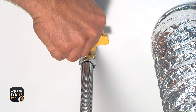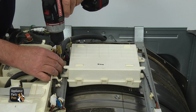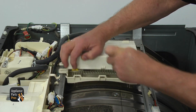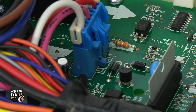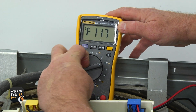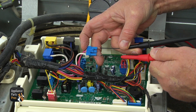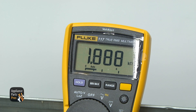If gas won't ignite, you can run a resistance test of the gas valve coils as a second test. For that, we need to get to the main PCB. Unplug the dryer and turn the gas off. With the top panel removed, locate the PCB housing mounted in the center. Remove two Phillips screws to free the housing. Using the flat-blade screwdriver, undo the tabs and open the cover. Locate the blue three-wire connector BL3 and disconnect it. Set your multimeter to resistance — the horseshoe-like sign — to K ohms. Touch the red and pink wires and then the red and white wires. In both instances, you should read 1.5 to 2.5 kilo-ohms. If the resistance is off or there is no continuity, replace the gas valve assembly.